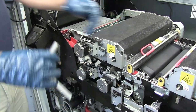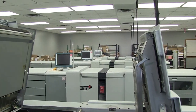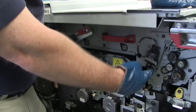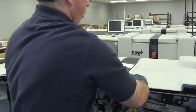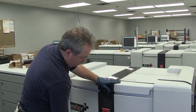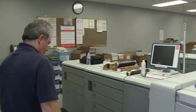You're going to close the right-hand side — both doors — then raise up the upper hood. Close the left-hand side, both doors. On this side, you may need to pull to the front just a little bit to get it to slide down. You want to make sure that this sensor is over this bracket — this little switch — which shows that the door is closed. Then come back and close the upper hood on the right side, and then close your front doors. Make sure you get this screwed in nice and tight; you don't want to over-tighten it, just make sure it's snug so that the doors don't move. Close the lower door.